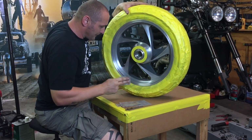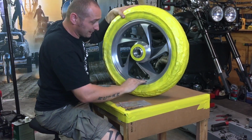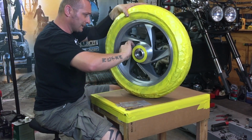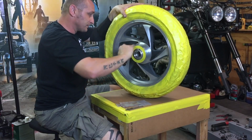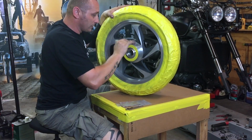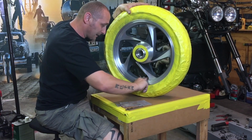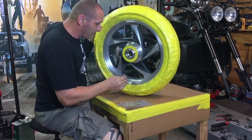I was thinking first I'm going to wet sand it, but it's not really important. Also, if I use wet sanding on this wheel full of holes all around, I have to wait a lot until everywhere is drying out, or blow it out with air. Now it's going to be dry and dusty, but I can easily clean the dust off using a degreaser, and I can put the primer on first, not a base coat. Yeah, because I try to use some good quality aluminum primer. What is good on aluminum?